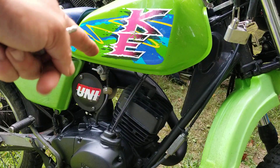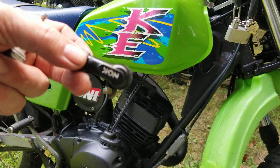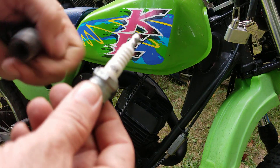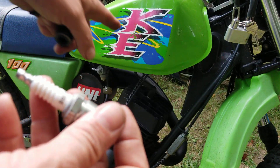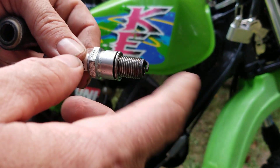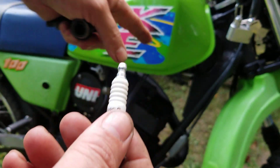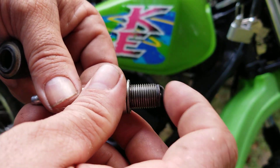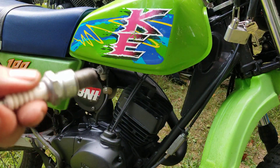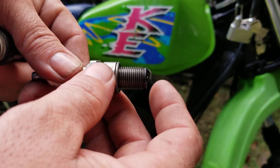When I told you guys this, I forgot that you have this style cap — this piece right here on top of your plug. If you put the black writing plug on your engine, the spark is going to be consistent. When you're checking for spark you'll see it flash once, twice, three times. But with the original cap setup it's going to look like one continuous spark with no breaks. The motor will run fine but you'll probably have a little hesitation and bogging, because there's no resistance.